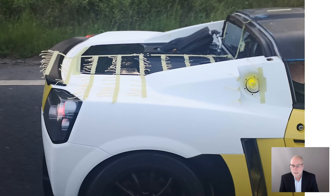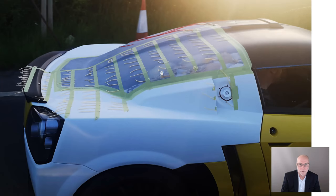But if we look here in front of this scoop opening, we can see again this separation where the fuel filler is. Now, I would suggest either this scoop is blocked, or if it is open to air, it's not flowing air very well at all. And so we have that separation bubble ahead of the scoop. But the most interesting thing is this massive area of separation from here to here. Now, what happens when we put that new panel on?